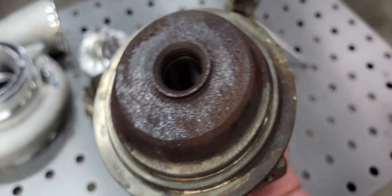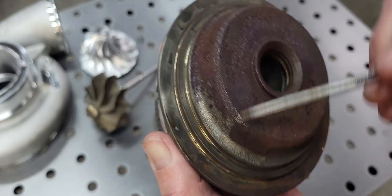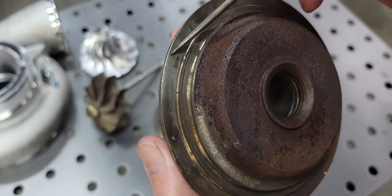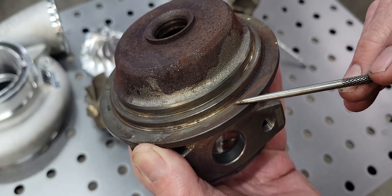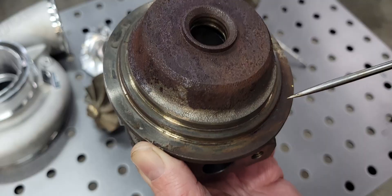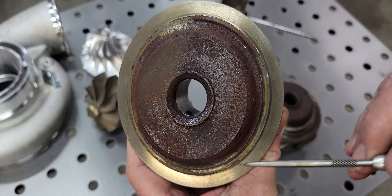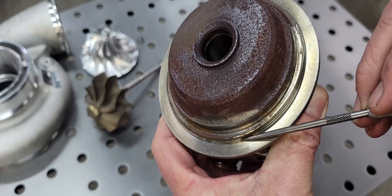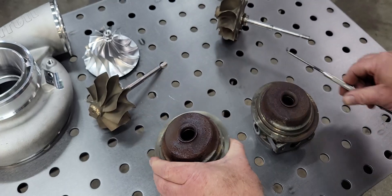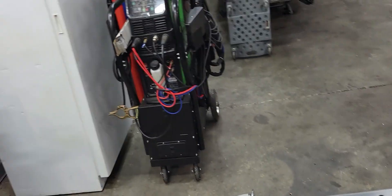What is causing this problem? I'm holding a bearing housing here — see all the corrosion we have here, and then how clean the surface is over here. This is the mating surface between the bearing housing and the turbine housing registration flange. This is the other turbo off the same car — as you can see, everything in the mating flange area is nice and clean, no corrosion, no contaminant.